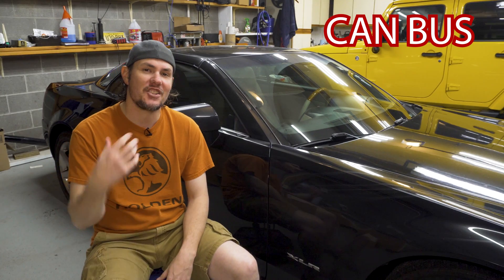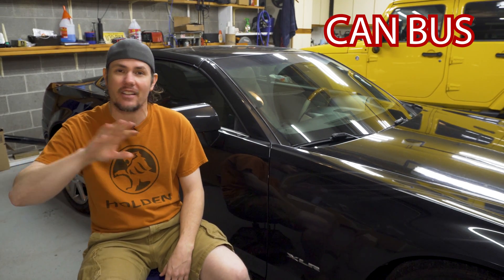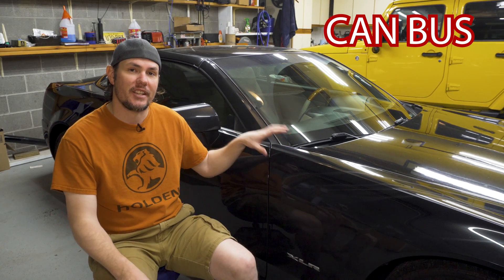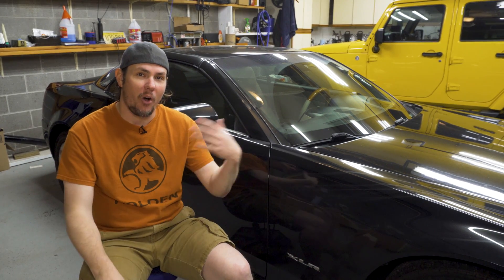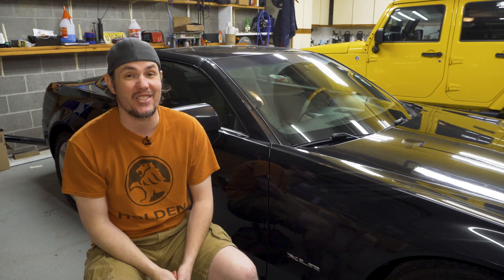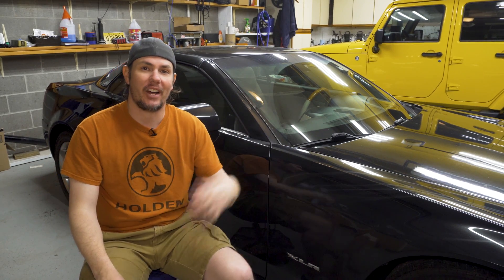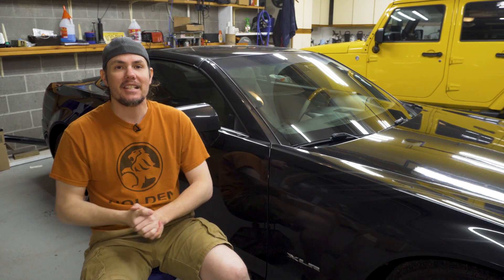Finally, AEM is the only one I know of with an OBD2 adapter that puts out a new parameter on the CAN bus. You scan for additional parameters in the scanner software and it shows up. Be careful though — CAN bus is not supported on all vehicles. Generally 2008 and up are CAN bus, but pre-2008 you need to double-check. Also, we're only considering gauges that support lambda, not just AFR, so we can tune things like E85 without weird scaling.